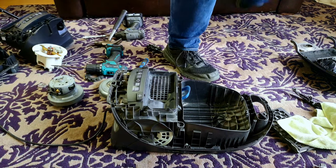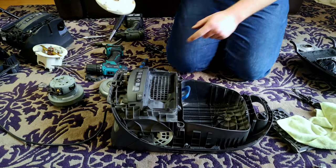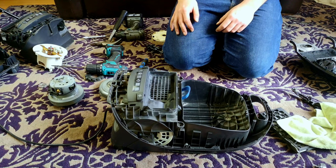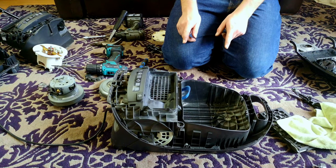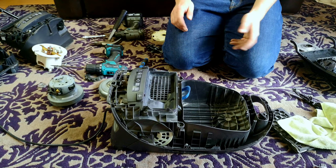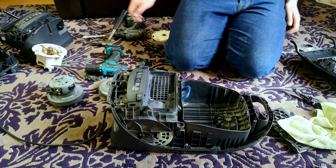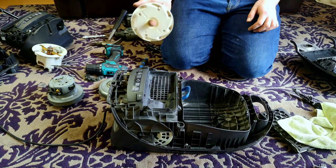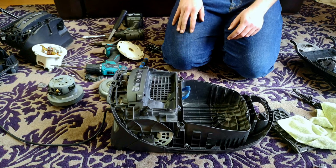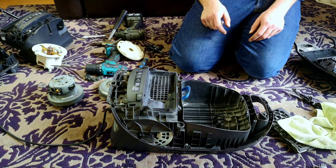With another motor torn apart, this is the problem - it was this. With the fan case tweaked out just a little bit to get to where we are now, that's got it working. So, do not use your Miele with water. If you do, get it apart as quick as possible and you'll probably be okay. Don't leave it until the bearings and all the rust expand everything out until it eats away at this part, because that really is a problem. But we've got one back together and that will do. Until the next horrible Miele experience, we'll see you soon. Bye-bye.